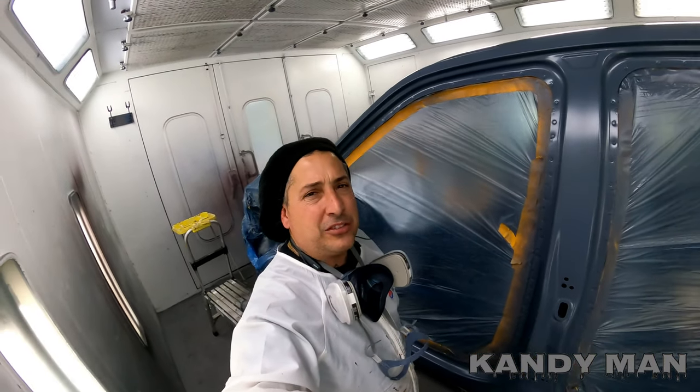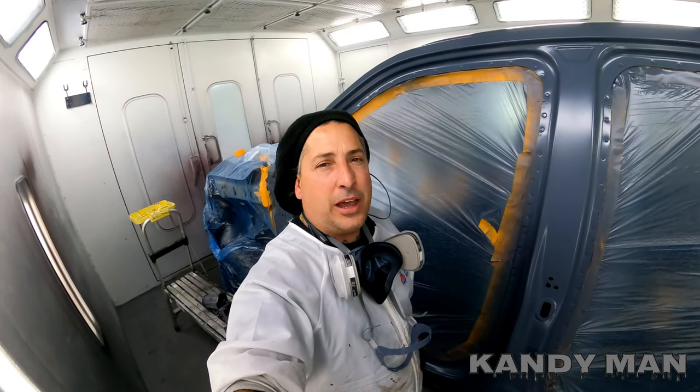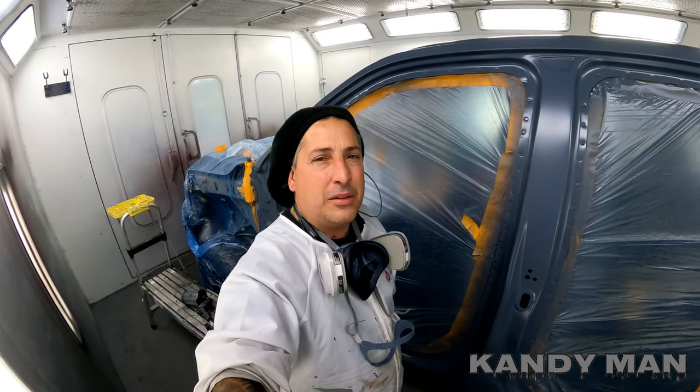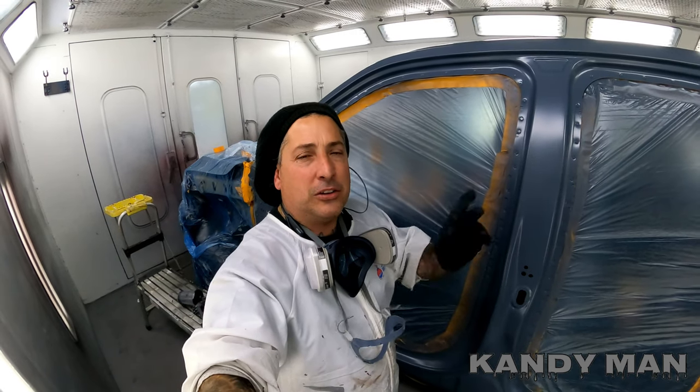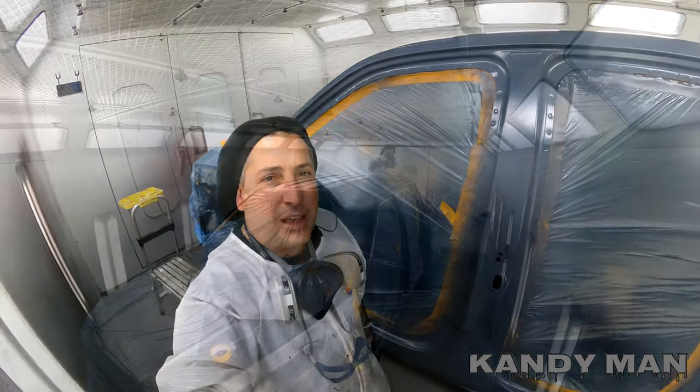We're gonna be moving to the base now, and this coat is J7. And we're gonna be using the 3M gun with the 1.4 in it. So the biggest part of these jobs is just getting a rhythm on how you wanna go around the vehicle. And once you start doing that, you'll build a pattern and it'll start to get easier every time you put another coat on. So let's get in the base in this one and see how it comes out in the end.